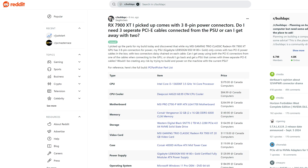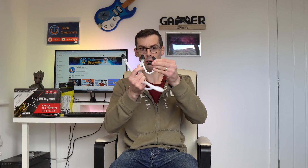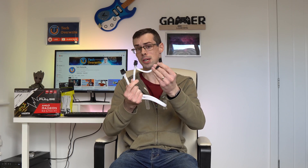This means you can usually power a three-connector card like the RX 7900 XT with just two separate cables. It has a TDP of 355 watts, so as long as you aren't overclocking the card, you should be okay to use two cables and then rely on the pigtail connector for the third PCI Express connection. Yes, I know I called this a horrible, horrible devil-spawn connector, and it kind of is because it lulls people into a false sense of security. But in this particular case, it's fairly useful, I guess. I still hate the pigtail cables though, as you can probably tell.